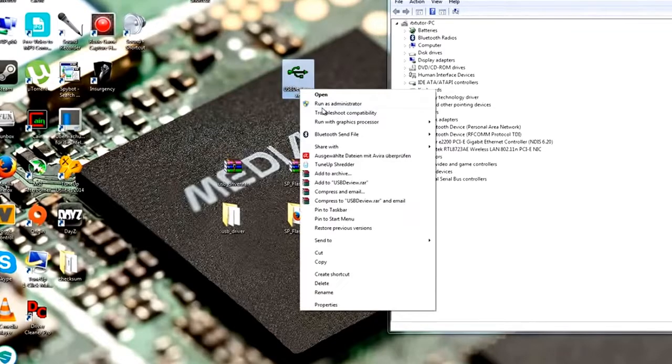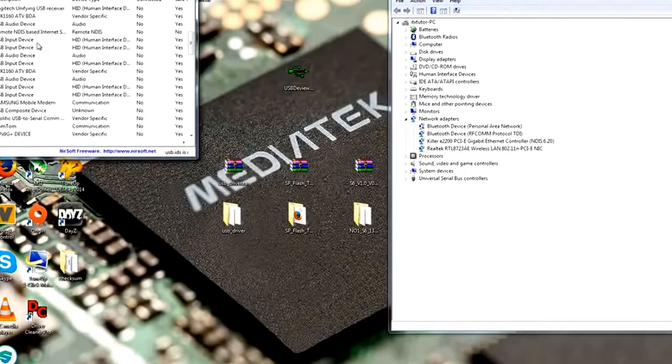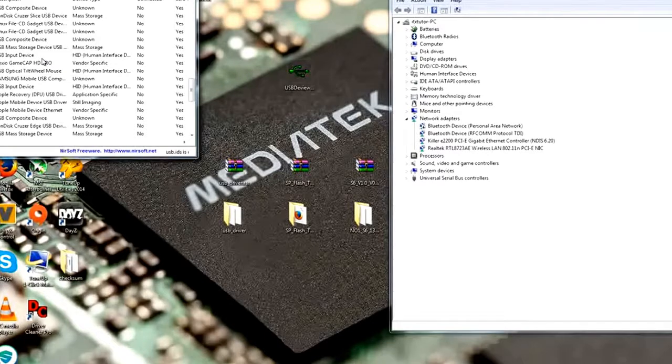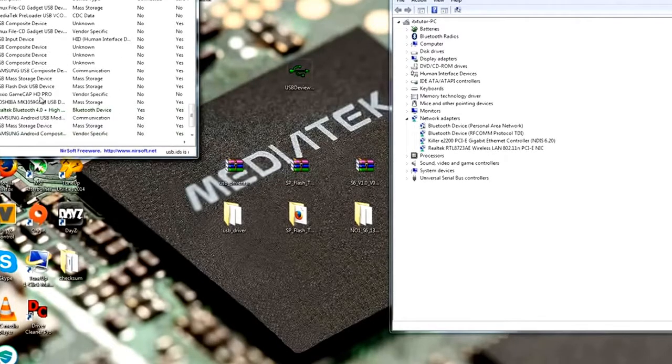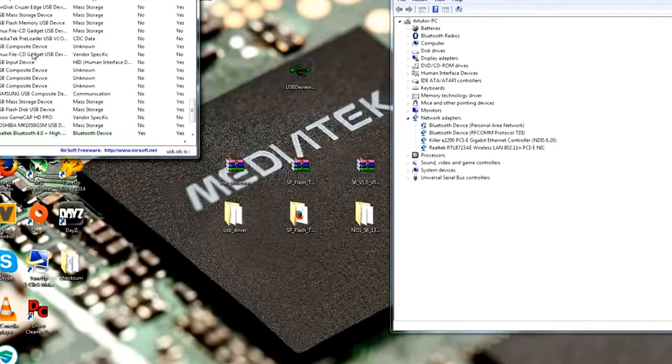try this tool. It's USB DView. The link to it is also in the description. And here you can search the list for the MTK preloader, it's right under description. And then you can do a right click on it and uninstall the driver. But you only have to do it if the MTK preloader is not showing up in the device manager, or if you have problems with installing the driver software.